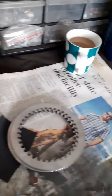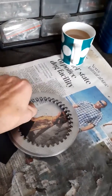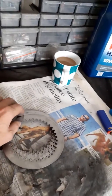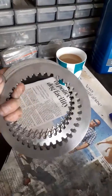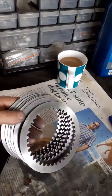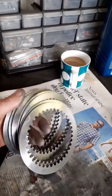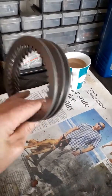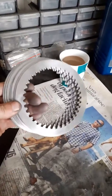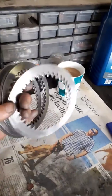There are a number of factors for clutch slip, but on the DRZ I can't avoid the glaze. I can't expect my DRZ to go three to four years without a clutch slip - you are going to slip this bike's clutch. So this is going to be roughly every three to four months as a maintenance job. This one has lasted me about six months, which is not too bad.